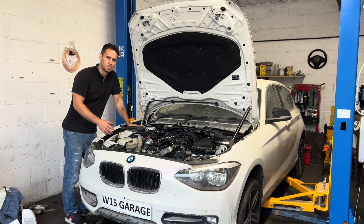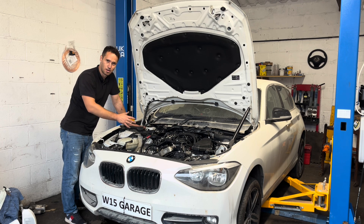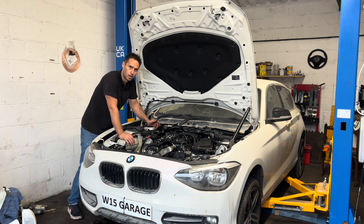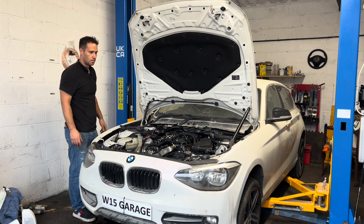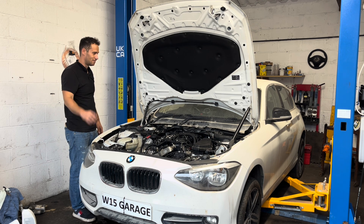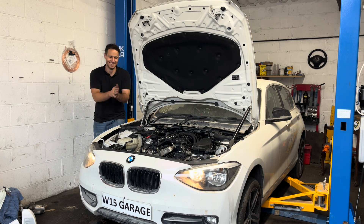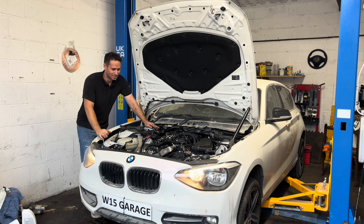I measured compression — 23 across all four cylinders. Apologies for the poor camera work; I'm focused on doing a good job and starting this engine. All I'm going to do now is plug the injectors in, and for the first time let's go full blast and see what's going on. Yes! Yes! Yes! Not bad!